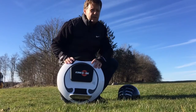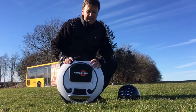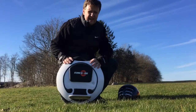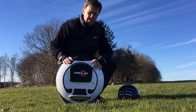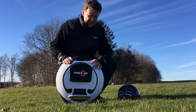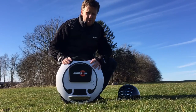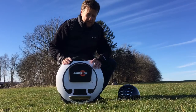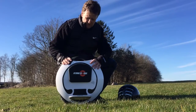Regarding the cooling fan — that's a good solution because there have been a lot of accidents reported online with MOSFET burnouts during rapid accelerations or decelerations, and a cooling fan should help with that. It adds a mechanical part that can break, but hopefully Kingsong has ensured you'll get an alert if the fan fails. Looking at temperatures in the app, my feeling is that it's at least 10 to 15 degrees colder than it was without the cooling fan on my previous model.